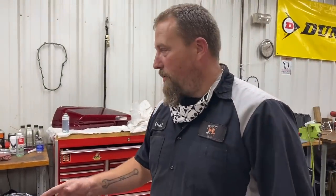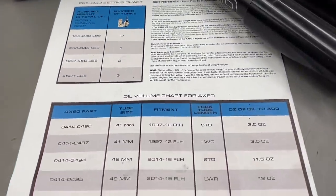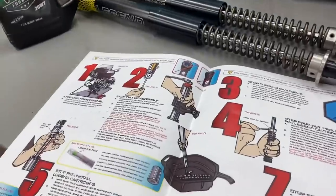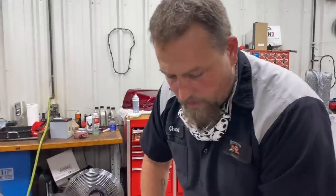On your forks we're going to do a complete oil change. Of course they come with their own oil, and we're going to do a seal change. It's not necessary to completely change all the seals and bushings every time you do one of these kits, but in this case we are. The instructions say if you think it needs it, go ahead and inspect and change them. We're doing the whole shebang. And then you're going to set me up with one turn? We are. It comes with a chart.